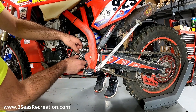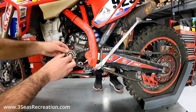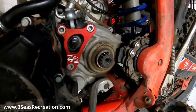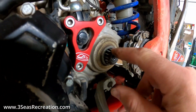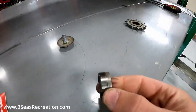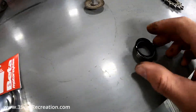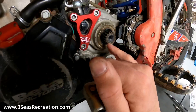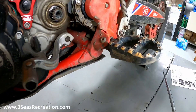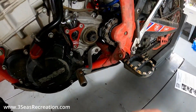Now we're just going to slide this off and slide the sprocket out of the chain. My sprocket's getting pretty worn — it's probably time for a chain and sprockets on this girl — but you can see, and I haven't cleaned the bike since we got back, typically there's a ton of mud in here. So we'll pull this out and you can see how grooved this ring is just from the time on the bike. You can see that little o-ring back behind it. Our new kit's going to come with it, so we want that o-ring to come out as well. We're going to pull this seal out next — you can use a screwdriver tucked up in here and pull it out, or this hook tool here.